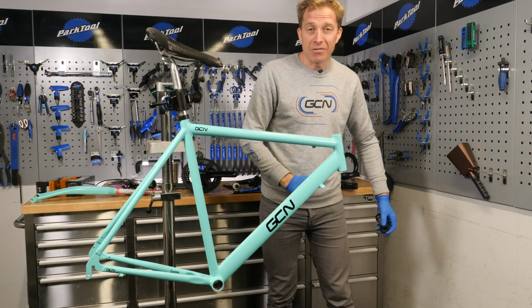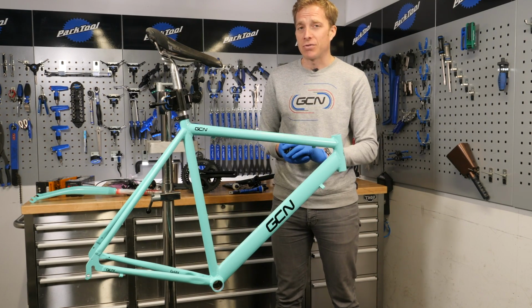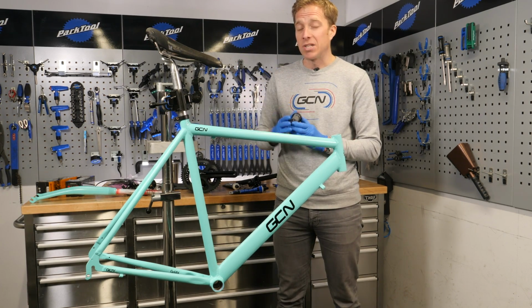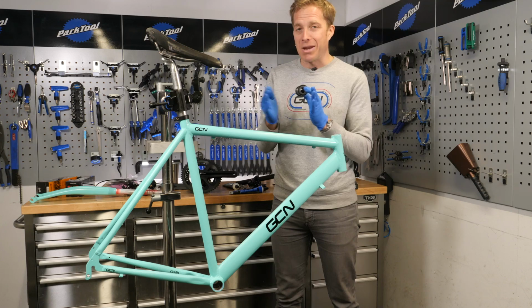The first thing I'm going to do is actually fit that bottom bracket in there. So again, like I said at the start, it's important to follow the manufacturer's recommended torque settings. For one of these Hollowtech 2, Shimano recommend in between 35 and 49 Newton meters. So I'm going to use 40 Newton meters. It's something I've always done. So again, I am sticking within the limits.